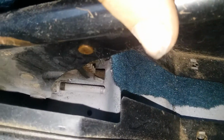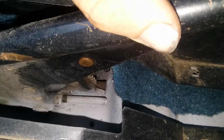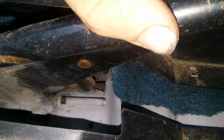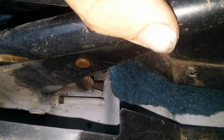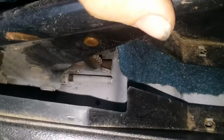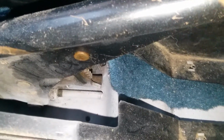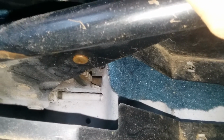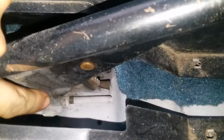It's a real quick, easy way to get your parking brakes working, as long as both drums are set right and you have a fair bit of life left on your shoes and drums. So they both need to be working well, and they both need to be hooked up or set the same within the drum. So then you can come up here and tighten that nut down until this is locking where you want it to.